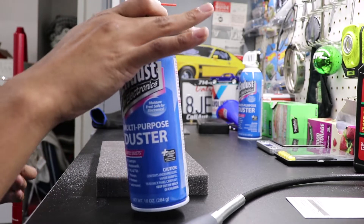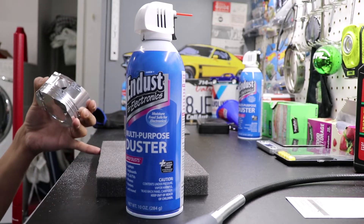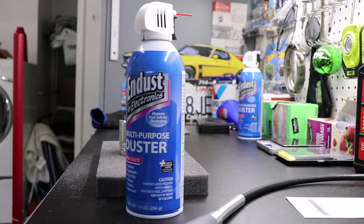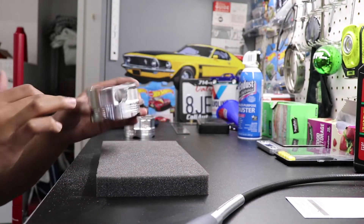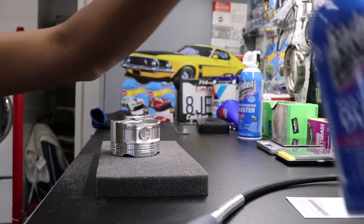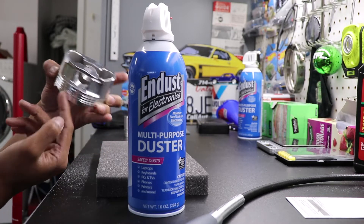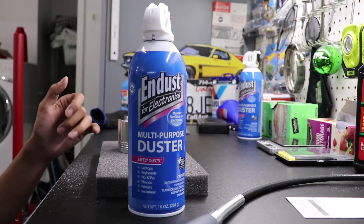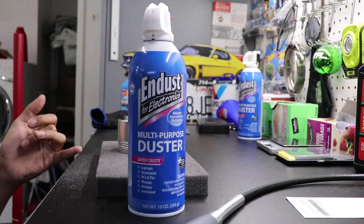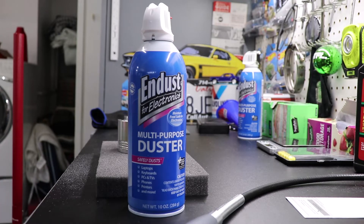I would like to note that I am also using a can of compressed air for a keyboard to go ahead and blow out any of the residual metal filings or dust in here so that it doesn't skew the results for the actual weight. Go ahead and use keyboard dust air, blow out everything in here, go through the holes where the oil is going to be coming through. It's good practice to ensure an accurate weight measurement, and it'll make sure you don't end up with metal in areas where it's lubricating rotating components like your wrist pin — these are a floating style, so they will be completely free to move. The last thing you want to do is score that and end up with a groove in your wrist pin.